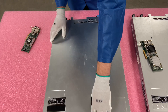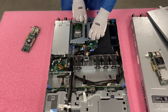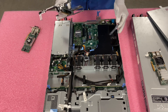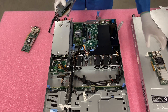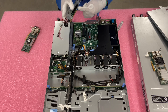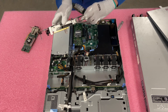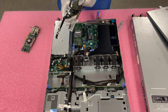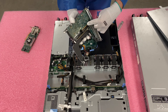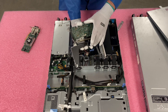It's real simple — you're just going to pop the latch like any server you've been in before. We're going to remove our riser by pulling it straight up. When you lift this up, this bracket will become loose, so just be careful it doesn't fall and damage something. You're going to need to line this up a couple of different ways: the plastic piece up top, the leads, and the top of the bracket. Once you have all four connections in the right place, you're simply going to click it into place and you'll see the leads are fully in there and it's fully inserted.